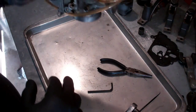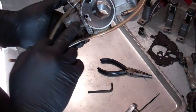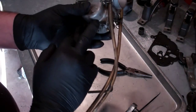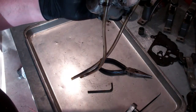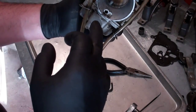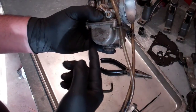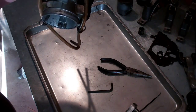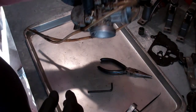When I pulled it out, I noticed that this carburetor was very, very dirty on the intake, so I'm not sure what we're going to find inside the bowl. If you put this carburetor on a freshly rebuilt engine, you're going to take all that dirt and grime — and whatever's in the gas — and it'll get sucked into the engine and ruin your day. So we'll start taking this carburetor apart.